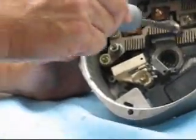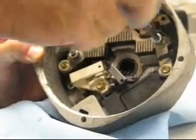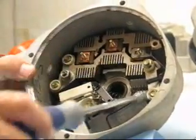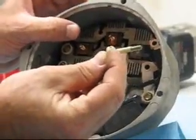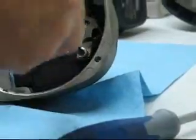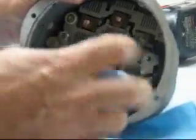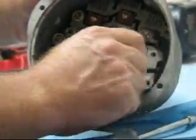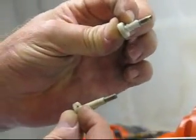We take these screws out — those are the two ground screws for the bridge rectifier. The upper portion of the bridge rectifier is grounded, so these upper screws would never be insulated. Now we take out the screws on the positive portion of the bridge rectifier, so these screws need to be insulated. There are two insulated screws over here and two insulated screws over here. Note that this insulator is the longest one and goes through the right side of the bridge rectifier. There's also a screw going through the voltage regulator — another insulated screw, but a short one with a short insulator. You have to make sure you get the long one going through the bridge rectifier and the short one going through the voltage regulator.